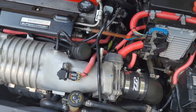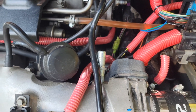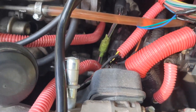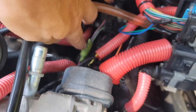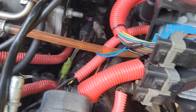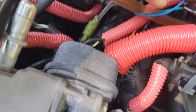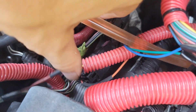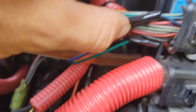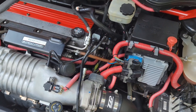All of these go into the same wiring harness, which is just behind your supercharger, kind of tucked down in there pretty tight. You can unhook it, pull it up on top of everything, or pull your supercharger out to make more room to do some soldering. Don't worry about the tape there — that wasn't me. All the tape you see is how N2MB recommends you do it. They don't want you to completely sever the signal wire for the yellow or the green — the manual states do not cut those wires entirely, just wrap them with electrical tape. Against my better judgment that's how I did it, and for three years it still works.